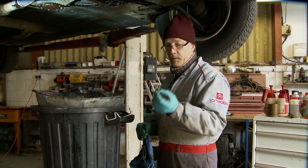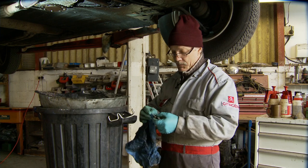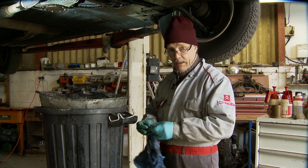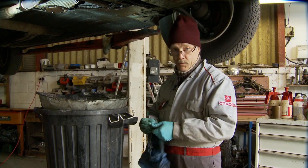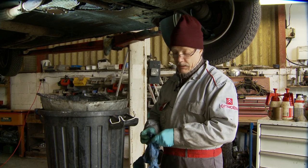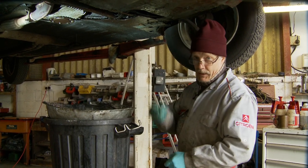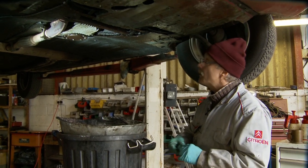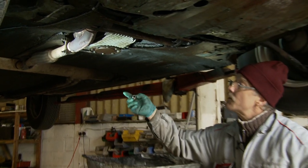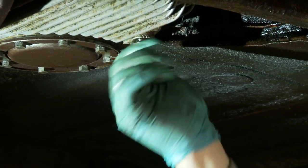When you've got the sump plug off, you'll find that it's hollow and crud from the engine will collect in there, so you need to clean it out — either in a wash tank, with petrol, or whatever. Whilst the oil is nearly dripped out and I have my annealed washer, I'm going to take the oil filter cover off, but the majority of the oil is now out of the sump.